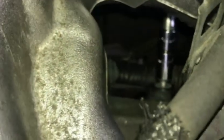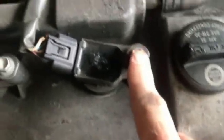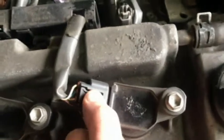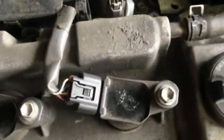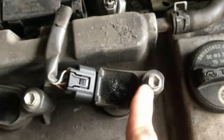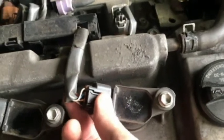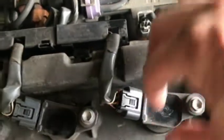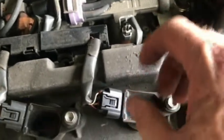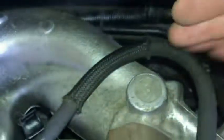I'm going to have to snake my hand in there and try to grab that bolt. We've got the bolt out on number five. You need to pull the wire connector off — you could do that first if you wanted to — but since I have the bolt out, I'm able to lift the coil up and get a better vantage point on it rather than having to go all the way down. I can kind of grab it from up here and pull the coil up.